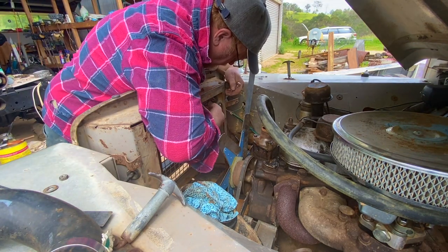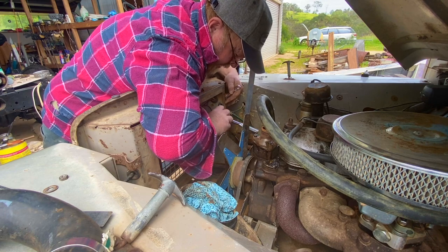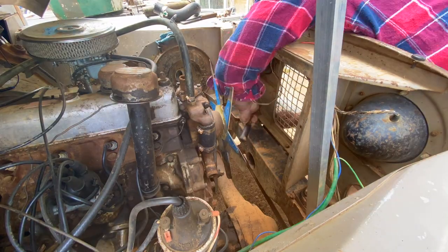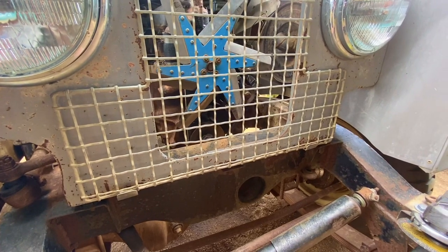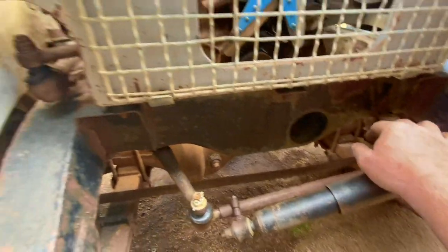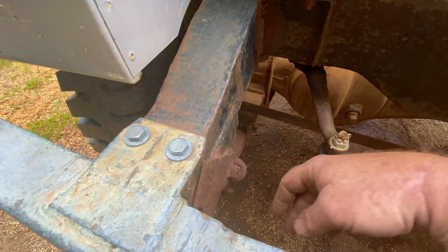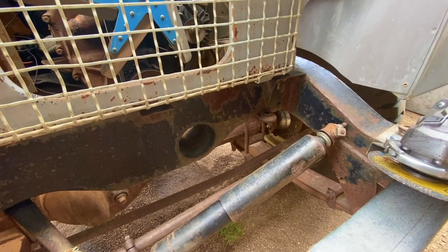There's a bit of a mess down here where the overflow has gone, taking the corrosion on the inside and putting it on the outside. While I'm busy removing old brackets from previous adaptations — there's a fixing for a previous steering damper, and one that attaches up onto a bracket — I'll cut this stuff off, give it a bit of tannic treatment to prevent corrosion. And that's another dodgy old repair gone.